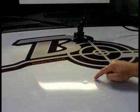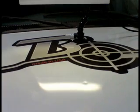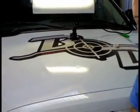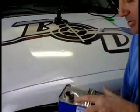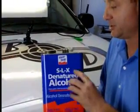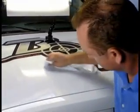Let's get into preparing for the actual pulling of the dent. You'll always want to wash the area where you're pulling. It's not going to work if you don't — you're going to have wax, corrosion, fallout from the sky, whatever is on the car. Take denatured alcohol — standard denatured, not rubbing alcohol. Get a rag, get it nice and wet, clean the area real good. It should dry up by itself real quick, and that'll get us ready to adhere the tabs to the dent.